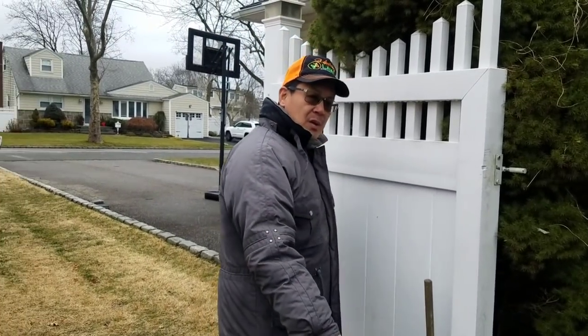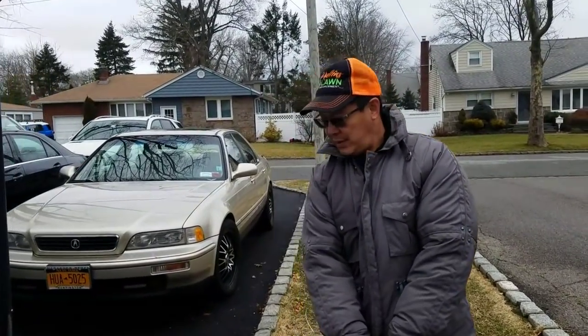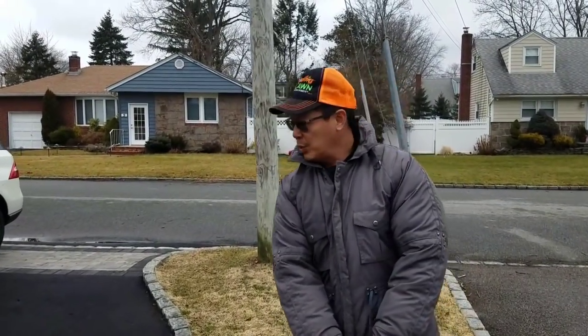Now remember, the problem with this generator was that Larry was one of the first guys to use this. I think it belonged in his family or something. He says that it was running just fine, but it sat for a long time, and then it wouldn't start, no matter what he did. Bobby also cleaned the updraft one-piece flowjet carburetor on this thing, and I trust him. He probably got it cleaned pretty well. But then they were trying to start it, and there was no spark.